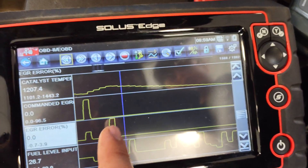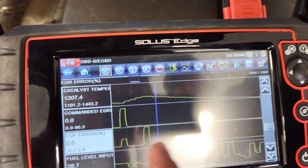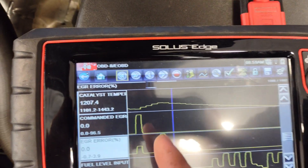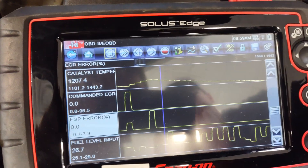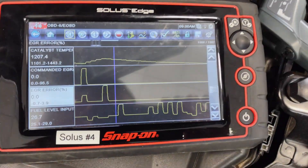That's because he went full throttle, so the TPS sent a signal to the EGR to turn it off — it thought wide open throttle was needed to get going. That's why we saw it drop off. Now we're going to do a test where that doesn't happen, so we can show it coming up and holding almost steady.